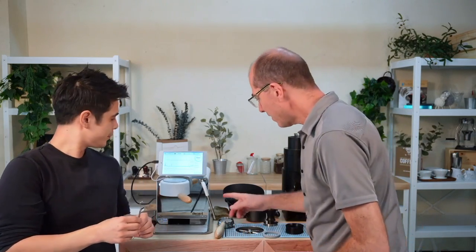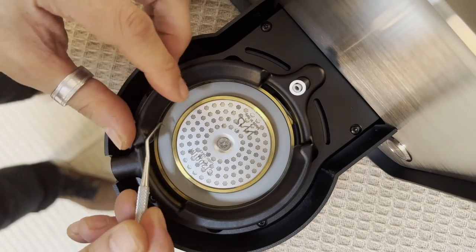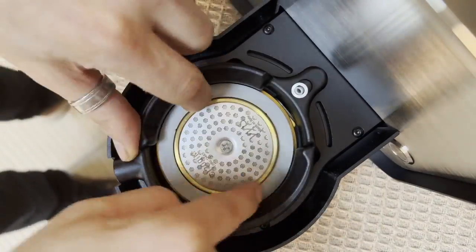Just to be clear: in order to get to the group head, you basically have to get down and get in there — it's pretty finicky, not easy. If you can bear to flip your espresso machine upside down, this becomes so much easier, not least because you usually have ceiling lights so you can actually see, but also you can bear down rather than bearing up. I fiddled with this for half an hour with my Boots dental pick before I flipped it over and had it done in three minutes. So if you're cursing your gasket trying to do it right-side up, flip your machine upside down and your life will be much easier.